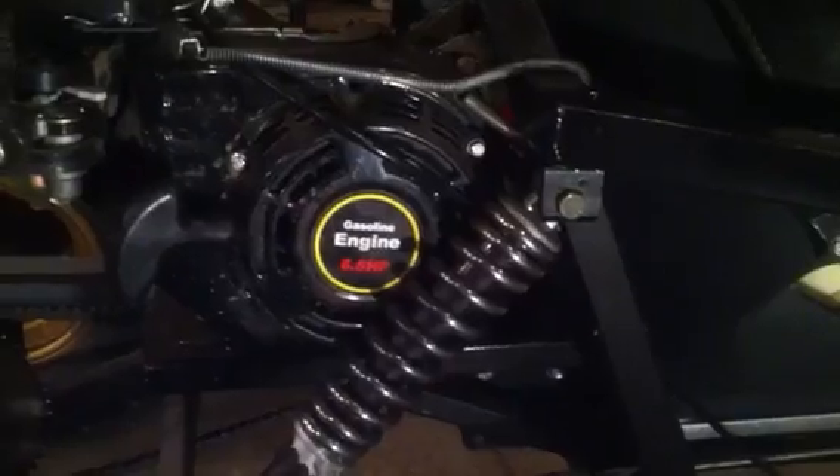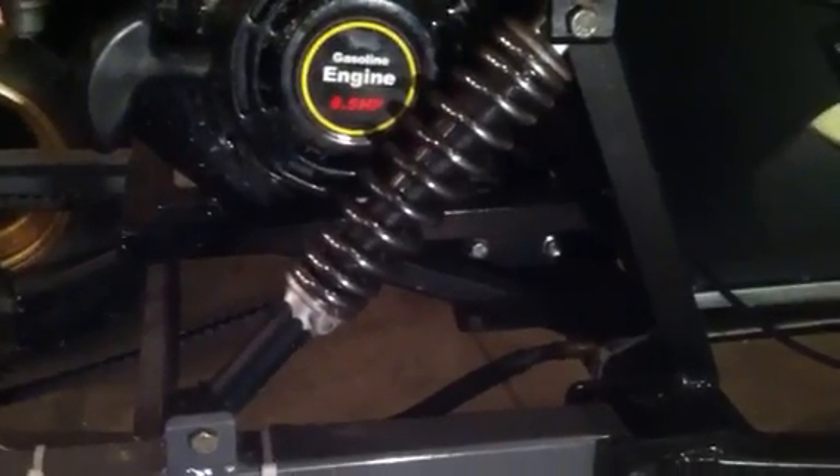There is a hydraulic unit that came off an Arctic Cat snowmobile that's been mounted to the side of the frame. It's basically a handlebar mount — it looks like there's a handle there, but that's linked up to the front pedal. In the back, the hubs had to be made special to hook up to these particular rims. The gas tank has been decoupled from the engine so the engine could get slid up just a little bit closer to the center of the go-cart, and this engine does not move with the swing arm — it's attached directly to the frame, so a little bit different drive setup here.